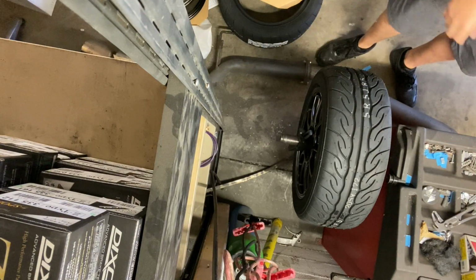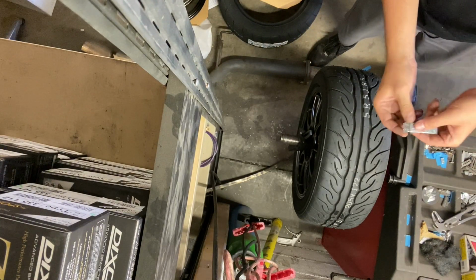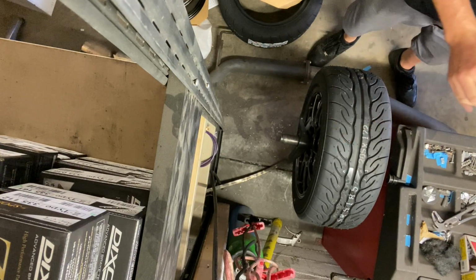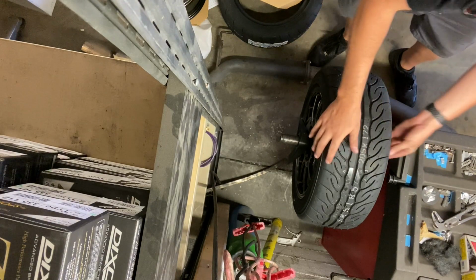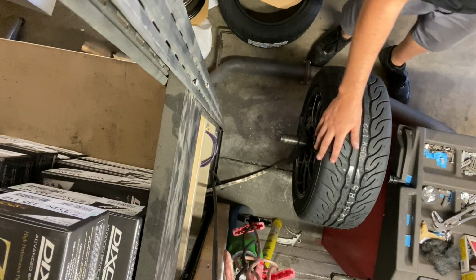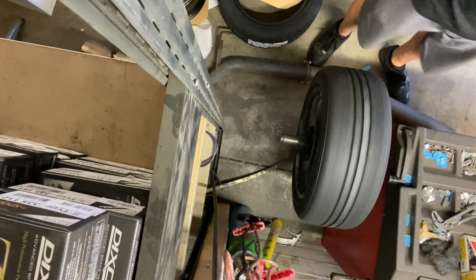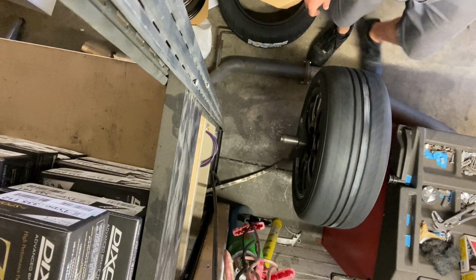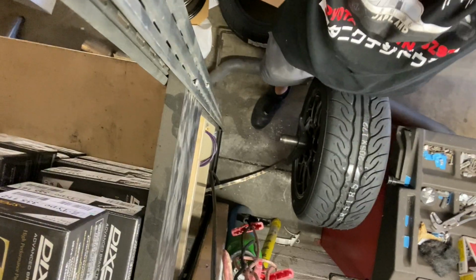which means the yellow dot on the tire was well aligned to the valve, so that shows that just one little square and the balancing will be perfect to 0. Let's take a look. And that is spot on 0, 0. That's what we're looking for.